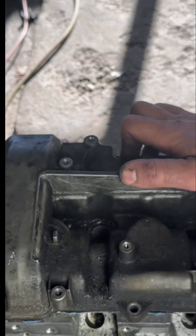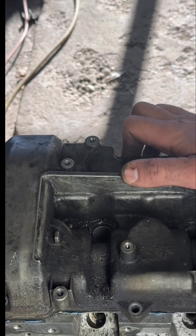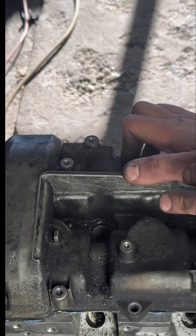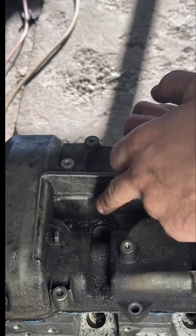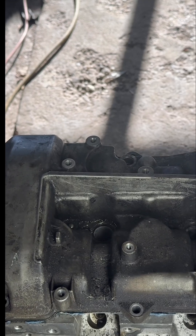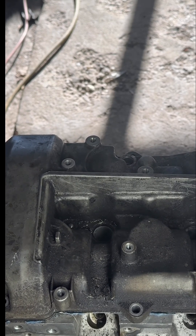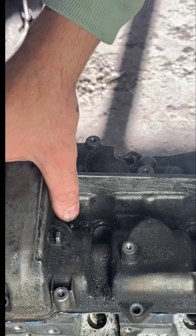And obviously, you have to take all six injectors out. If you don't have any chance to take the injectors out, then this is where you can actually just pray, drill this out, hope there's no leaks. Since this is a damaged cylinder head, I am going to take the valve cover out so we have a lot more space. And this is the correct way of doing a repair on these engines.